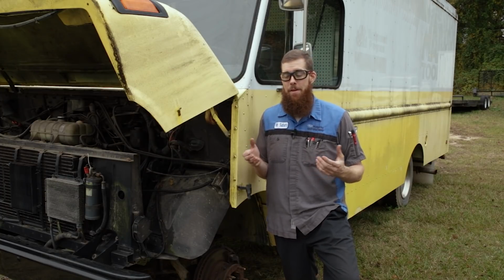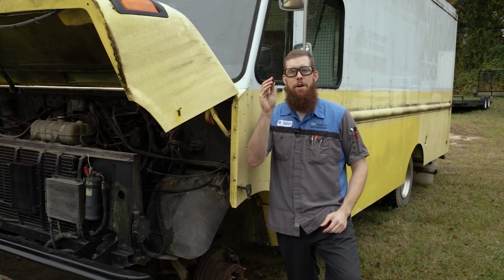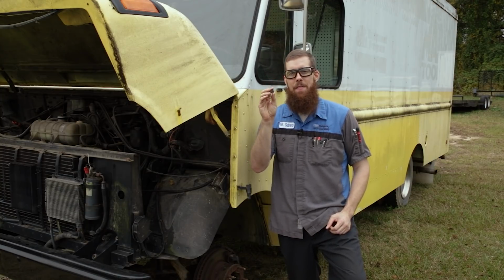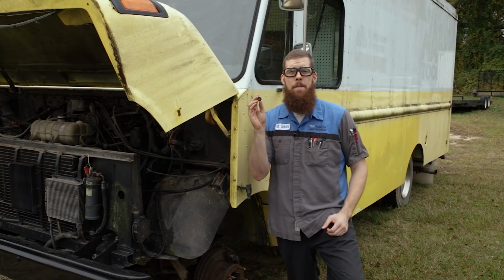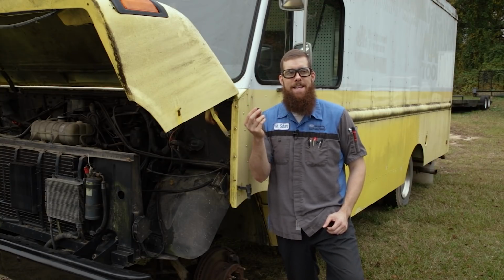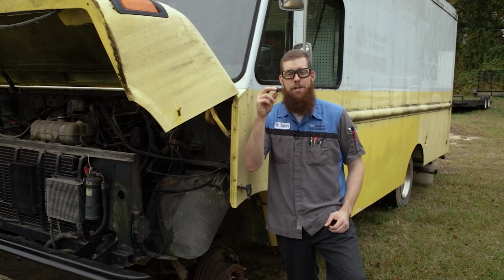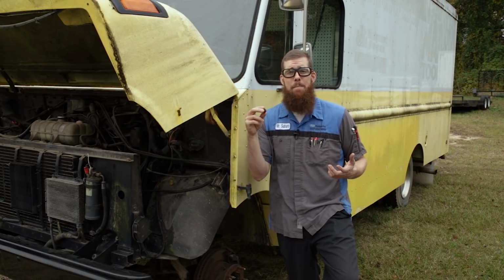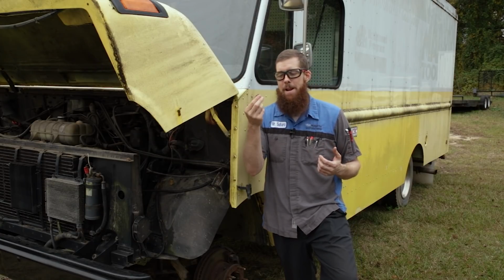But the first thing that we're gonna work on today is this little brake bolt. It's the shoulder bolt I showed you that had the hex head in it that bolts that plate in place that locks the caliper onto the caliper bracket. Well, again, trying to beat the darkness, sunset coming, I over-tightened it. It is a shoulder bolt. Shoulder bolts, you basically tighten until the shoulder makes contact, and that's about it. But I was in a hurry and getting it tight, and sheared the head off.